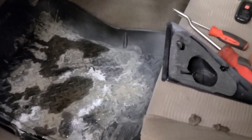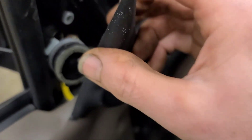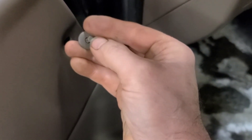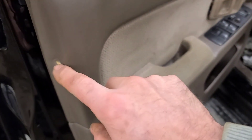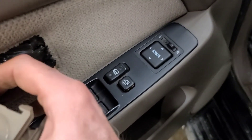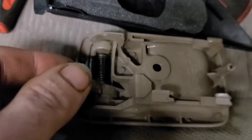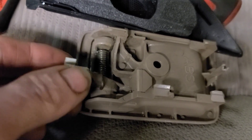To remove the door panel, pull the key out so we don't have to listen to that. You can pry this little cover off at the top — there's a plastic pin and then it hooks at the bottom. There are two push pins here; push the center of the pin in until it goes below the surface and then pry the pin out. There's a Phillips screw here, then slide this forward and undo the link to the rod. On this door handle there's a little plastic clip — flip it off the rod and the rod will pull straight out, and pull the door handle off.